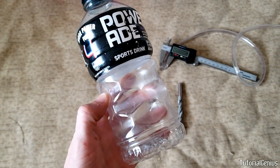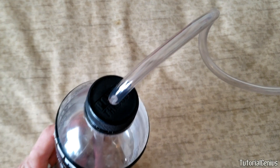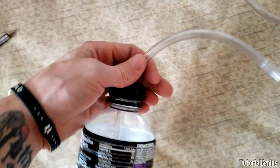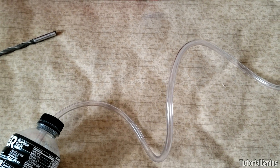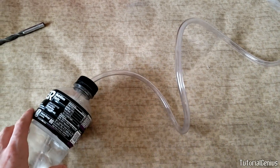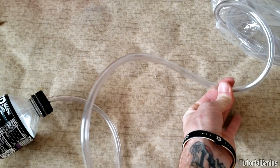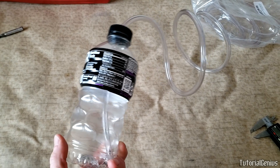When using this, make sure it's absolutely dry — no old liquid or water or anything in there. Now the hole is drilled; you can see it's a really tight fit. The line runs all the way to the bottom so we don't have to have too much brake fluid in here. The last thing is to cut the line so we have enough tubing — you don't want it too short and hanging from the caliper. If your car is off the floor on jack stands or ramps, account for that. Make it long enough, and then you have a one-person bleeding kit right there — very simple.